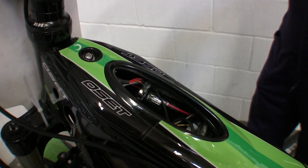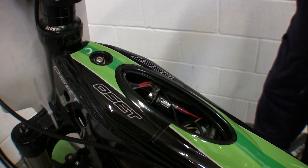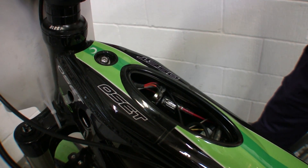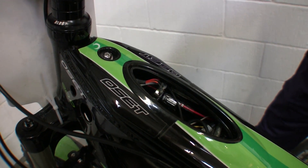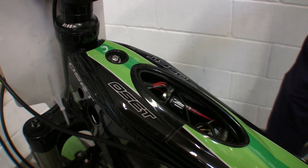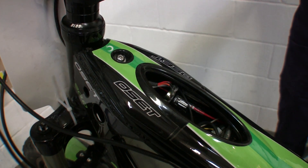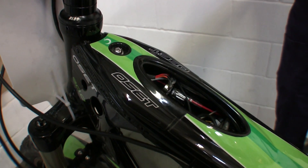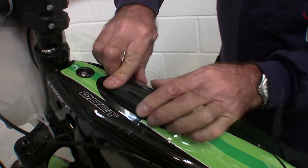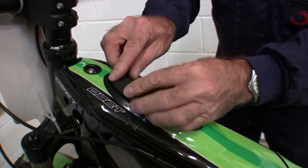Higher settings can be very deceptive, so caution must be used when building up to these. With the bike on a stand, the faster response often looks ideal, but in reality when in use it's too much for many children. Even the most advanced riders rarely want the fastest response. At the fastest settings the bike pulls a lot more power, so runtime will drop. Always build up slowly and remember that the fastest response settings are for experts only, and certainly never for riders under 10 years old.